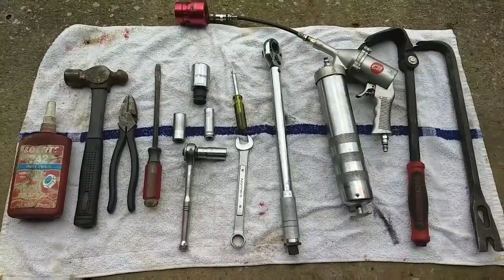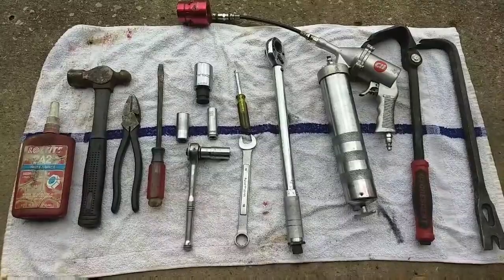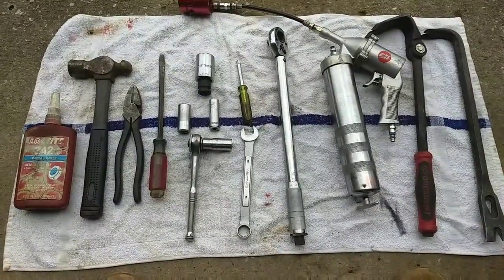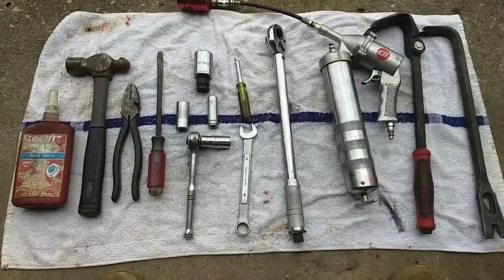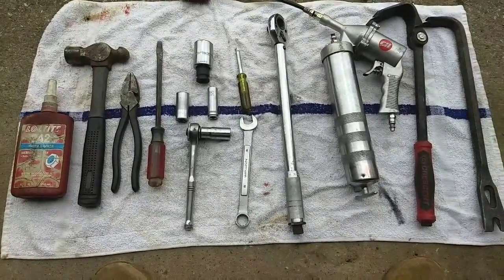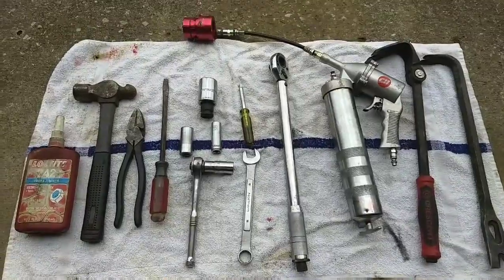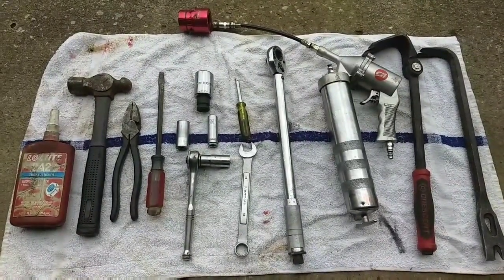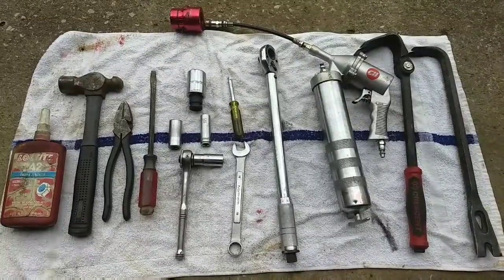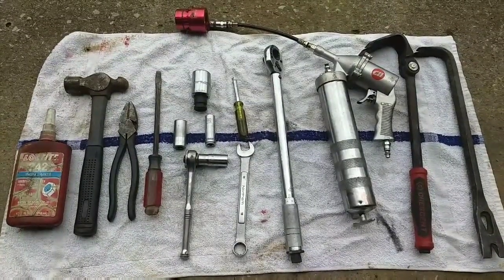Here is the tool list — everything that I needed to get this done. The axle nut socket is an inch and a sixteenth. The lug nuts are three quarter inch socket. The brake bolts were fifteen millimeter and the control arms were an eighteen millimeter on the ratchet. You need an eighteen millimeter wrench, and then a torque wrench to torque your axle nut back. A grease gun and my little tool to grease the wheel bearings. And the pry bars and the hammer to pop out the axle, and the pliers and screwdriver help with getting the cotter pin out from the nut.